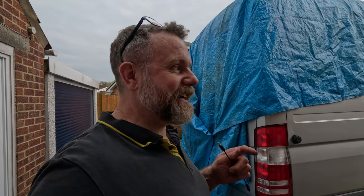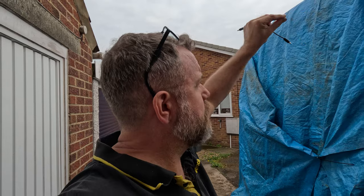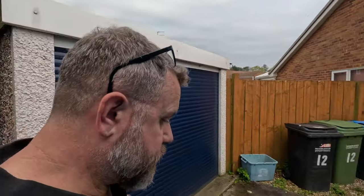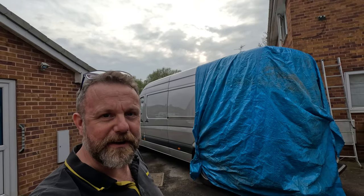The rain did stop and I came back out and finished that little bit at the back. Then I got the ladder out and took the reversing camera off - those are about a hundred quid so if I can fix it I will. I'm going to sit in front of a movie tonight with it in pieces - I can already see it's had damp in it. Sometimes you can just clean up the metal connections and it might be okay. When I was up there I also noticed rust around the door seal area so I quickly ground it, red-oxided it, and also treated another rust spot on the roof. Now she's going to sit like that for the night. Hopefully we get some weather in the morning and get some Hammerite on.